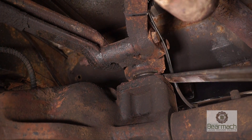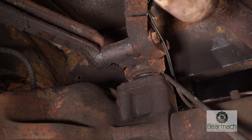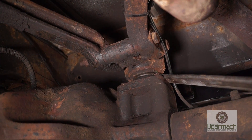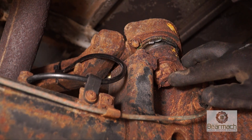The other fixing is the A-frame ball joint. You put a bar underneath it and lift it — if it's got lift it's worn and it needs replacing. You can usually tell when these are worn by the banging you get when you take up drive. You can see the lift on that. The gaiter is also split so this needs changing.